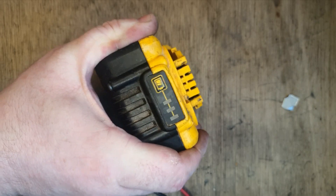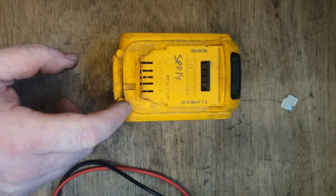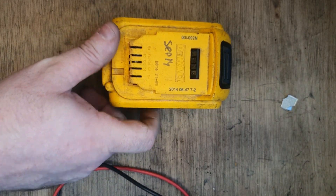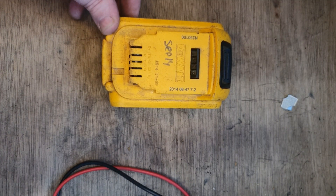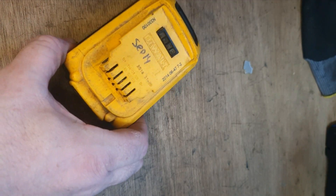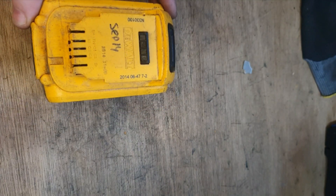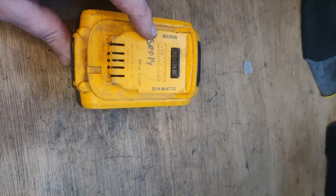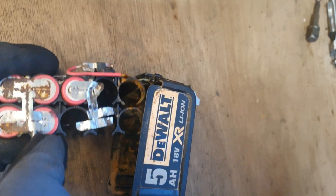Because of what we've just done, I can feel the heat in those front cells. I would leave that sitting overnight to see if those cells are good or bad — to see if they can actually maintain that voltage, or if they drop. Sometimes they drop the voltage and that's them done, sometimes they're okay. So we'll know in the morning. It's now official — that battery has failed. These two cells have not held up to the jump start, they were knackered. What I can do is take a couple of cells out of this donor pack. These two are showing a good voltage, so I'll just pop these out and hopefully they'll do the job.